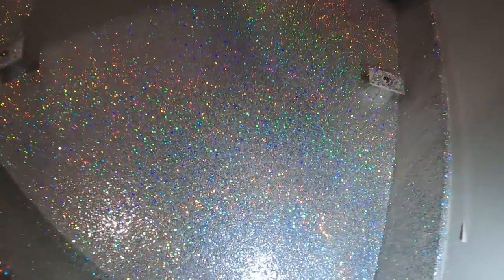We have those caps on top of our drains, protecting so that the epoxy is not flowing outside. So we're gonna take those out in 24 hours when the epoxy is still a sticky substance. If we take those out now, all the epoxy will flow outside.